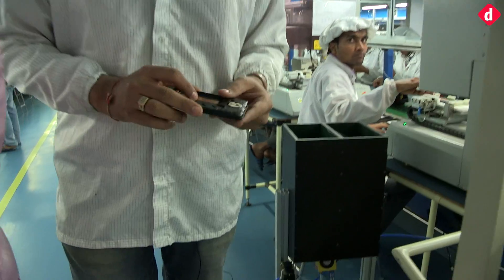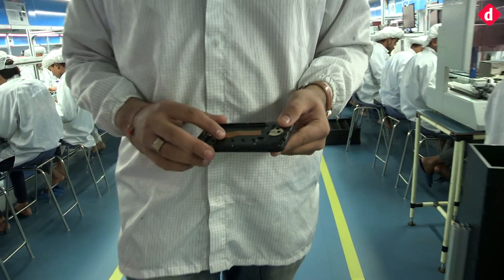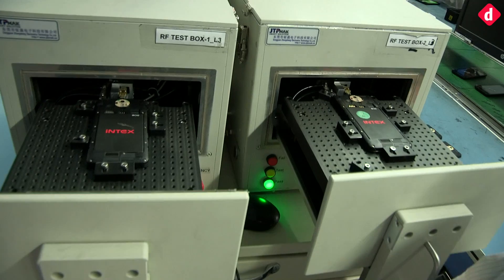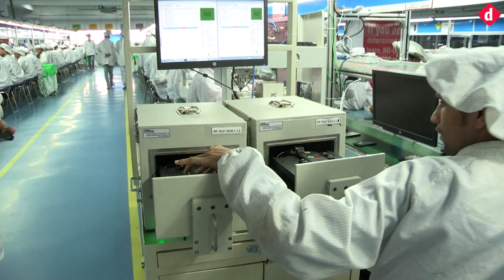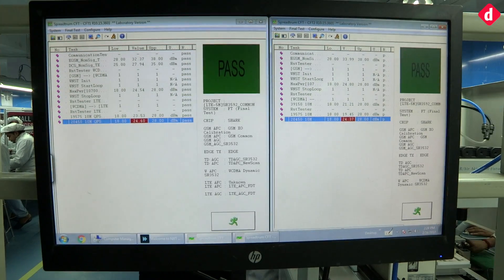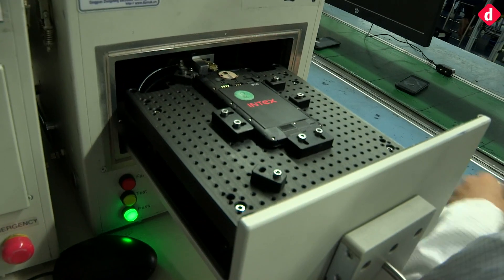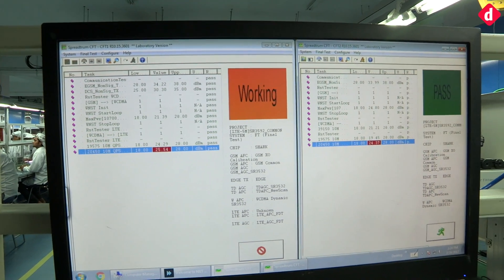At this particular step, the phone is not yet ready to be sent to market because every phone has an IMEI number. Here we are doing RF testing — radio frequency testing. The basic function of a phone is to get signals, and if the phone is not getting signals the customer won't be able to use it. We check whether the set is getting signals via the antenna, using what we call a BTS. It checks all the radio frequency system — all frequencies including DCS 1800 and CDMA functions. The machine itself tells you whether all testing parameters like low value, highest value and current value are within specification.